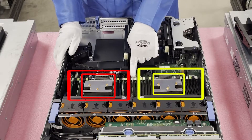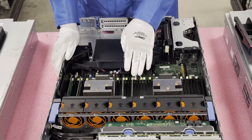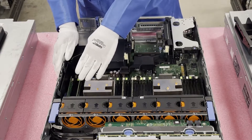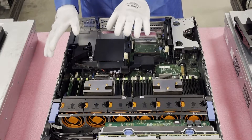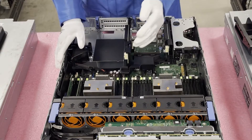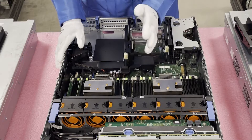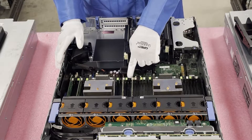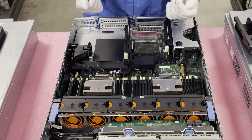For CPU 1, slot A1 is right here — it's the white slot; there are two whites together, and it's the one on the right if you're standing from the back. The first module goes into A1, the second into A2 which is the next white DIMM slot, then you come all the way over and keep loading the white DIMM slots. We recommend keeping a good balance. The 12 DIMM slots go white, black, green, white, black, green — that means there are 4 memory channels with 3 DIMMs per channel. You should always fill each color fully: fill all whites first (multiples of 4), then move to black for 8, and load all 12 if filling the whole side.